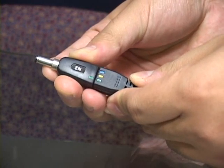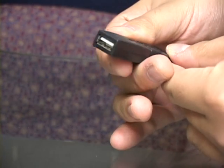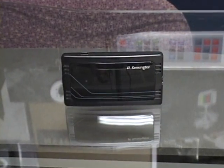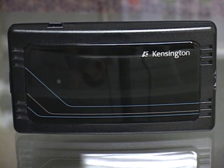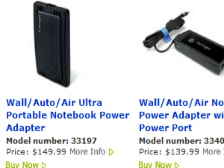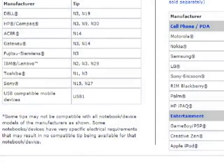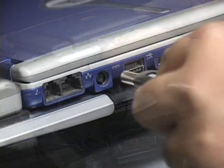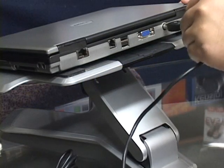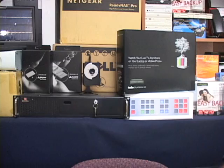This is accomplished by using a series of Kensington Smart Tips. These tips are sized for particular models of notebooks and electronic devices, and they contain all the circuitry to ensure that the correct voltage and polarity is applied to your gear. As an added bonus, the Kensington Smart Tips are compatible across the entire line of Kensington power accessories, meaning you can add universal power adapters, extension cables, and international travel plugs as needed. Our retail pack included 12 Smart Tips and an output cable. The adapter is compatible with laptops from Dell, HP Compaq, Acer, Gateway, Fujitsu, IBM, Lenovo, Toshiba, and Sony. We tried it with everything from our power-frugal Dell Latitude D410 to a 17-inch HP Pavilion, and it powered every laptop we could find.